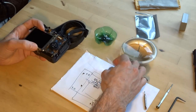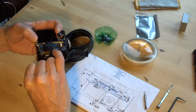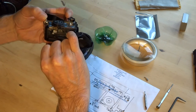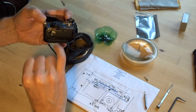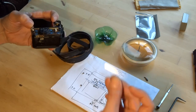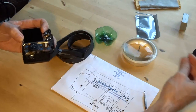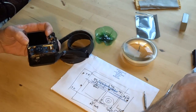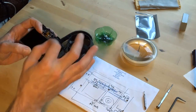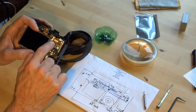5 screws for the outer casing, including the one underneath the interface in there. Don't forget to take that one out in the first place, which I've put number 3. Don't forget to remove the plastic cover on your new screen. Don't do anything with the battery in the device in case you short something, and especially when disconnecting any ribbon connectors.